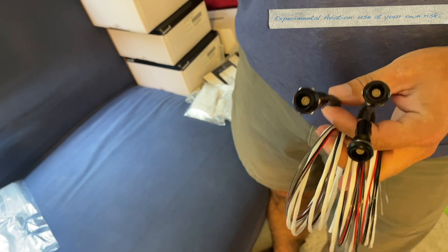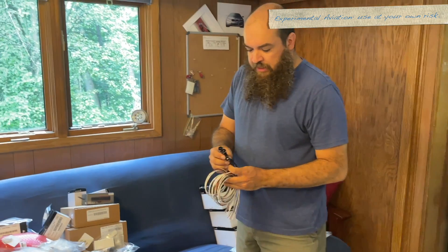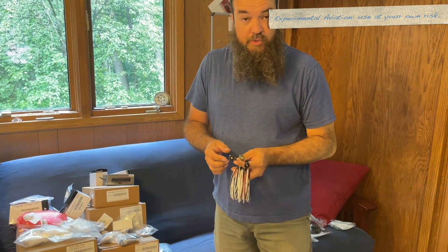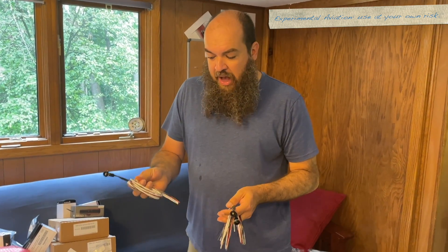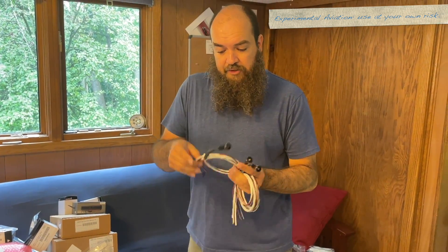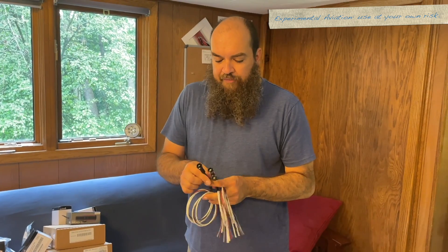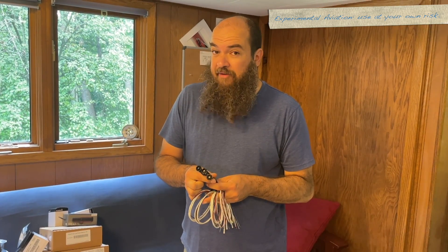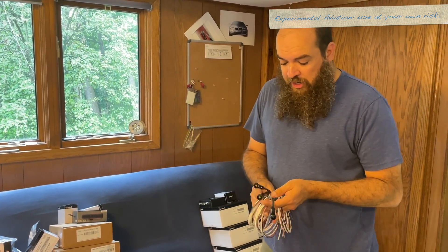I'm a big fan of powered headsets — I don't want to be dealing with batteries for our headsets. This is the LEMO — L-E-M-O — Bose plug. It's a standard plug; most headsets that do powered headsets use the same plug. I got the kit from Bose for these connectors with the pigtails already on them. I can't tell you enough how handy it is to just plug your headset in and never worry about batteries. My headset is always in my RV-9, always plugged in — I've never had to deal with batteries. Really worthwhile.